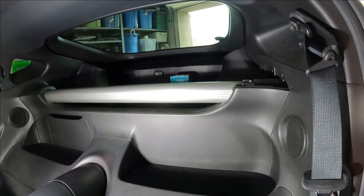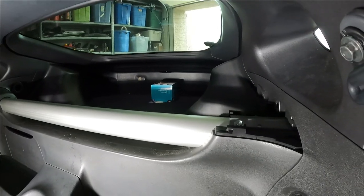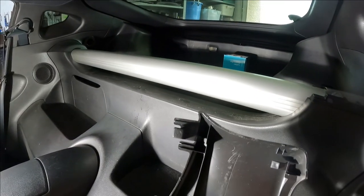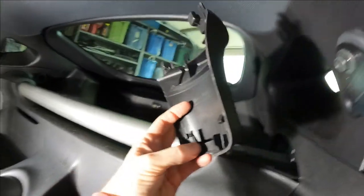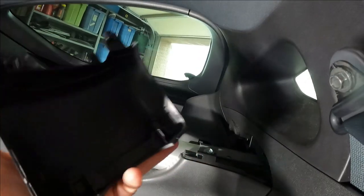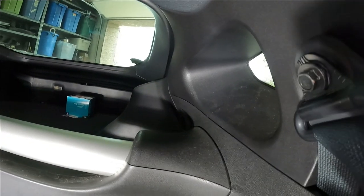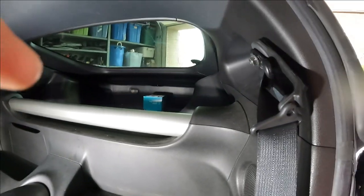All right, I told you a long time ago that this back panel on the stiffening member just comes right off, and so I thought I'd at least show you what that means. The clips on the side that face the wall just slide in, right? And then here, I can get the lighting right, these clips are little hooks, right? Not much pressure, there's nowhere to push. And so all you do is set this on top of there so that it's sitting away from the wall and tap it. And so then it's stuck and you just slide left to get rid of it.